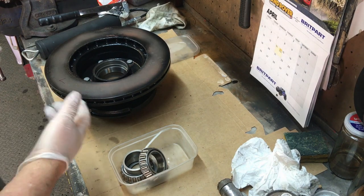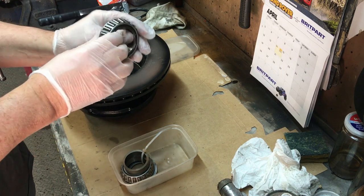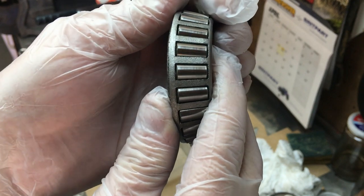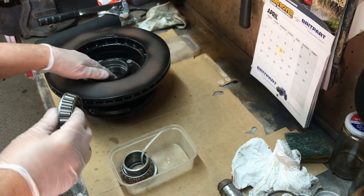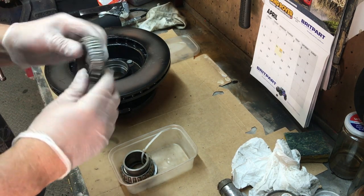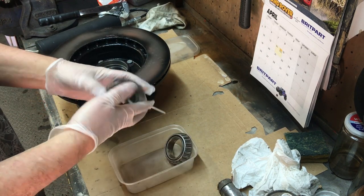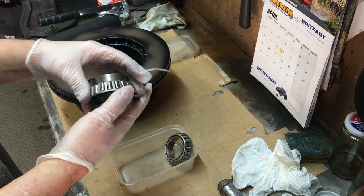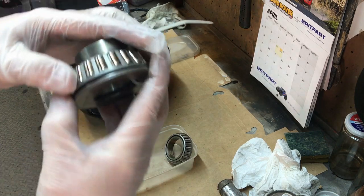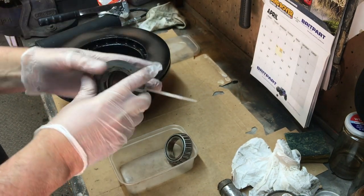So it's time to get messy now — we're going to do the wheel bearings. If like me you're stripping yours and you don't need to replace the wheel bearings because they're in perfectly good condition — you can see on here these rollers are shiny, there's no scoring on them, no chipping on the bearing, no scoring in the race, everything's lovely. You want to know which bearing is in and out but you can't mark them because you need to wash them. So what I always do is put a washer on the outside — cable tie the washer to the outer bearing and that way you know you're good to go.